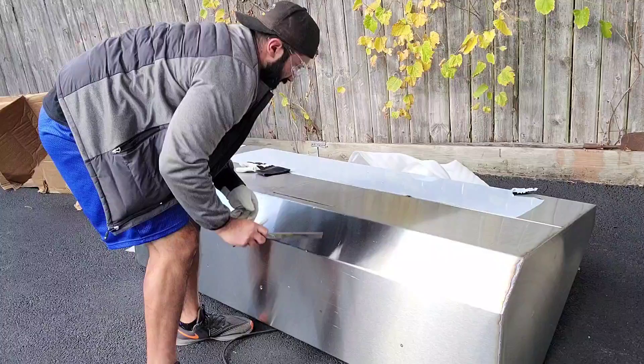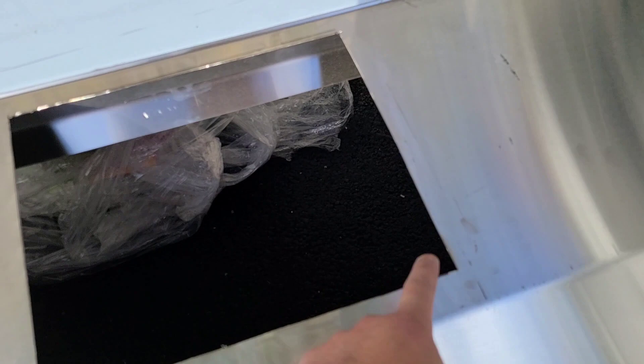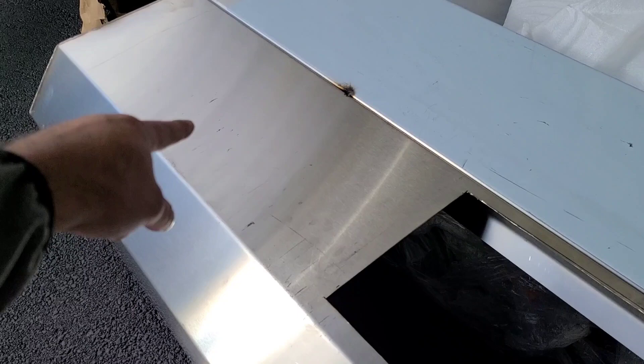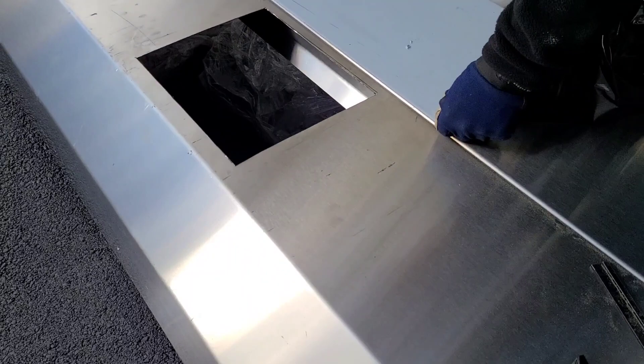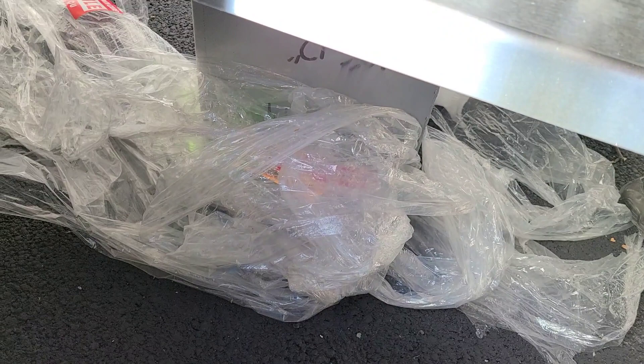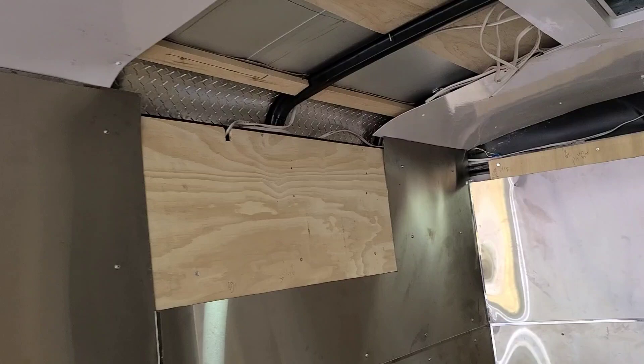This is how the hole should look on the concession window for the exhaust hood — it's about 12 and an eighth by 10 and an eighth opening right there. Make sure you cut exactly between your studs on your 2x4s. On my food truck it fits better exactly right there. So there's a 6-foot hood and that's the opening. We're going to use this duct and cut the exact height we need. This is the spot where we throw up the hood right now and give it a preliminary marking to verify all measurements before cutting the hole up top.